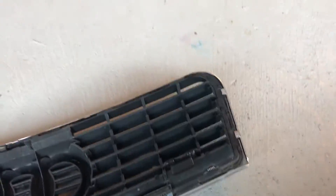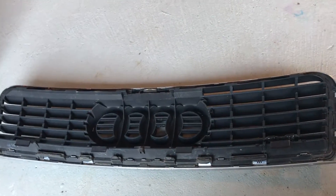As you can see, the grill is no longer attached to the car. I'm going to go ahead and pull it up. I'll rest it down so you can look at it at a better angle. These clips right here are the ones you disassemble — all this top row — and there should be one on each side, sorry. You disassemble towards the bottom of the grill, not the very bottom part. Like I said, I'll put some pictures in the description with that area circled so you can follow along. It's pretty simple and self-explanatory.